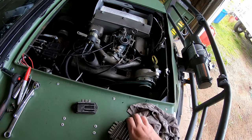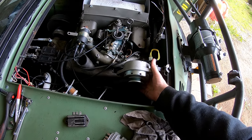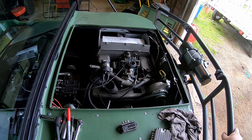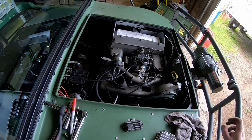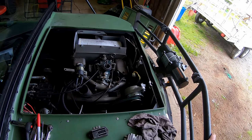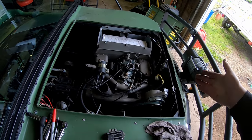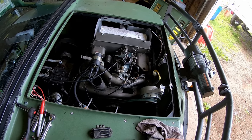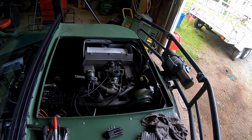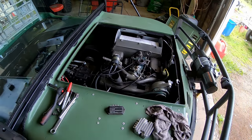I'm waiting on the paint to dry. Once it's done I'll put my bracket on, adjust the belt nice and tight, then wire everything up. The two cables coming off this alternator are AC. Being a permanent magnet, you don't need to charge it or create any stator winding — it's permanent magnet, basically a dummy alternator. The AC voltage comes off purely from spinning. It's almost like those pedal bike headlights where you pedal and the headlight comes on — literally the same concept.